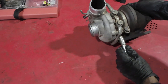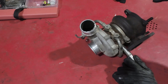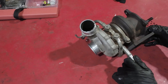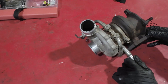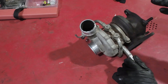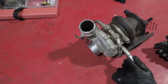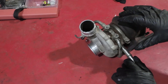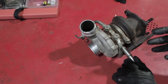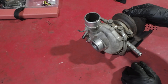What happens is that air needs to be as cool as possible. The cooler the air, the denser it is, and the more oxygen it holds. The more oxygen the air holds, the better it burns with the fuel you put into the engine. The more efficiently it burns, the more power you get. So what we really need is cold — or as cold as possible — air going into the engine. Having boiling hot air coming out of a turbocharger is not ideal.